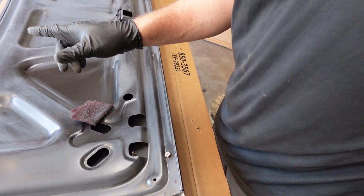So I'm going to do the fender, and then that way when I set up and do the primer sealer, I can do both of them. And then usually two pretty good coats, about 10-15 minutes in between coats. And then like I did the trunk, that last coat, wait 30 minutes. And then you can actually put your top coat, which mine's going to be Le Mans blue, but red, purple, white, whatever it is.